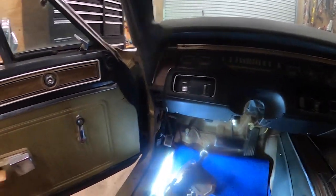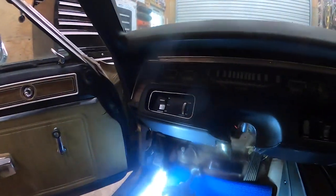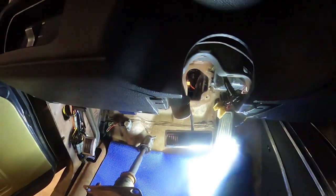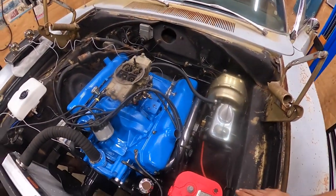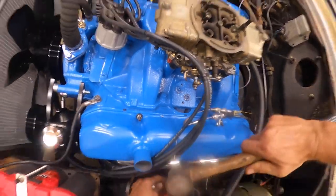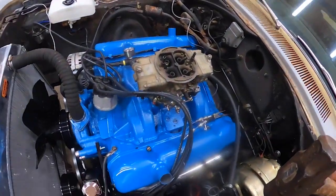I'm gonna try to do this very methodically here. I've done it by myself before but it's a pain in the butt. The steering column is already locked up — it needs to go like this, yeah that's right. I'm aiming for that spline on the gearbox to match up. We got the steering column in — it's loose, but I'm going to knock the pin in here for this little knuckle and that should be about done on that. It's pretty well in there, just want to get one more love tap on it.